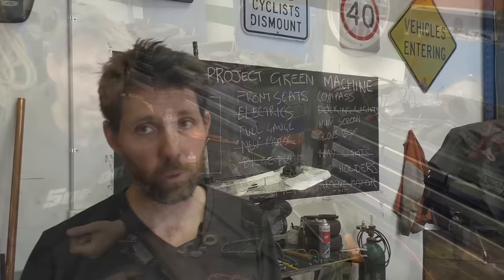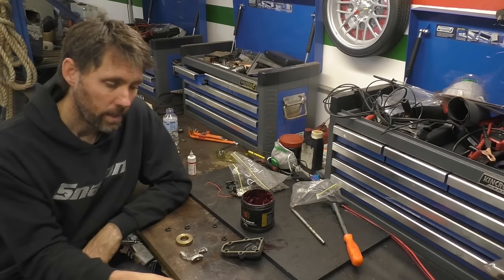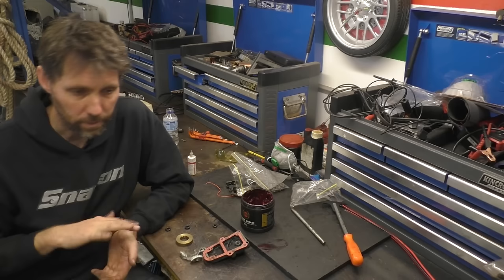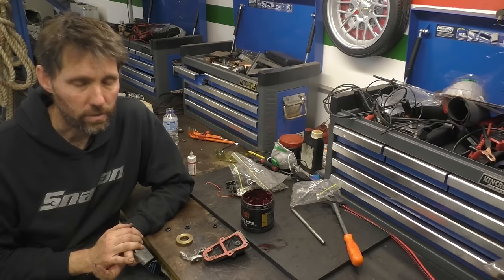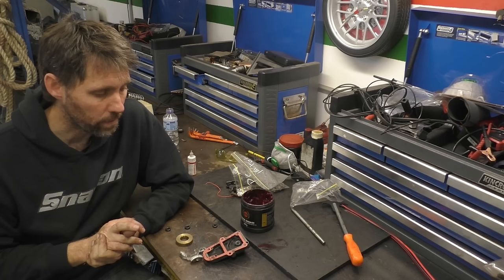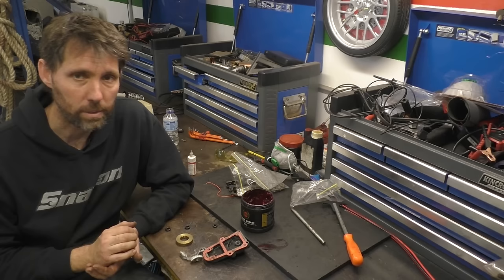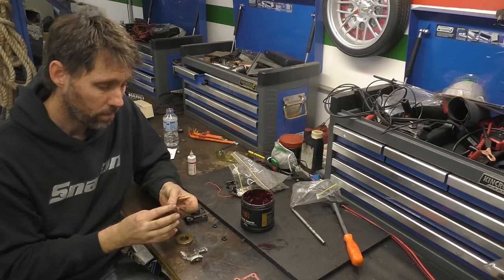Back from Evinrude now — they had quite a bit of the parts in stock, which is good. I got a new spacer to replace the old one that had disintegrated, a couple of new O-rings for the shift linkage, and a new gasket for under the plate. They did have quite a few of the hydraulic seals, but were missing some parts. Having a chat with them, I think we're much better off just overhauling these hydraulics completely — they're more likely to have other internal issues than just that bit of corrosion on the seals. So I'll get those off and get them completely overhauled. But I am going to push on with the motor itself, because although it won't drive on the water particularly well, it won't stop us starting it here on the trailer.